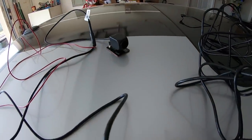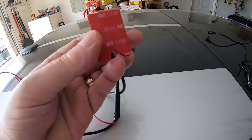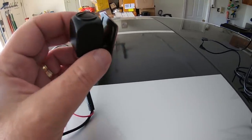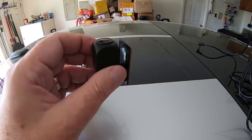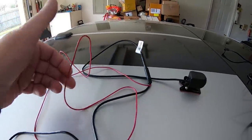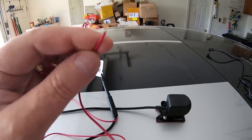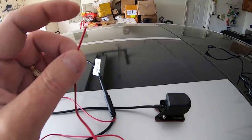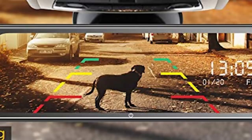I've just cleaned the back windshield and before I mount the rear camera I want to show you that I'm using 3M sticky tape because I don't want to drill into my bumper or below the rear trunk hatch — I want to put this in the rear window. The camera also has a red wire which is a signal wire that you hook up to your reverse lights, and when you put the car in reverse the dash cam mirror will show you grid lines.